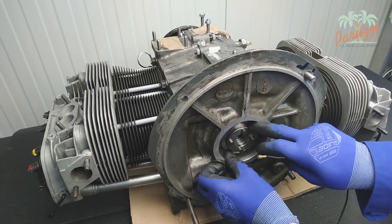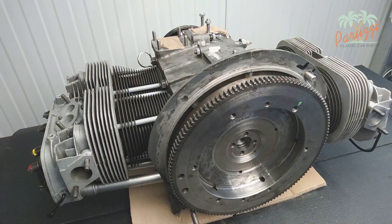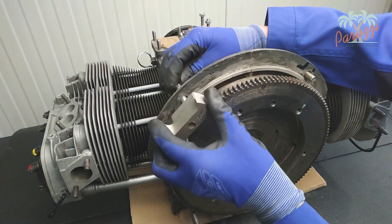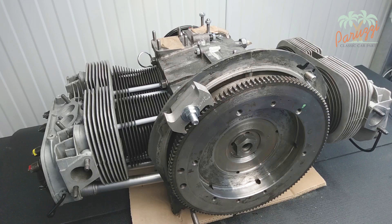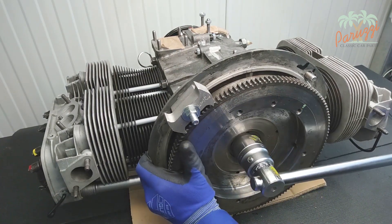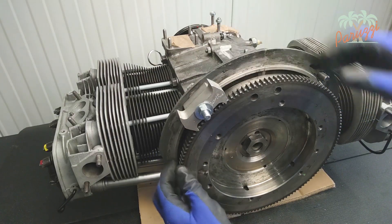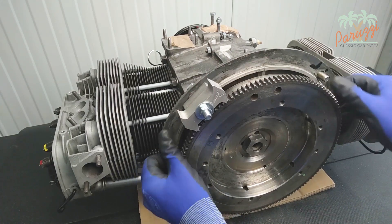We reinstall the three shims on the crankshaft for measuring the crankshaft end play. Next, install the flywheel. You should not torque the gland nut — just tighten firmly; a 36 millimeter socket wrench is sufficient. The flywheel lock tool will be needed to tighten the gland nut. The engine may remain loose on the workbench; you won't have to apply very much force. The gland nut is now tight enough to measure the end play. Loosen or remove the lock so that it offers no resistance.